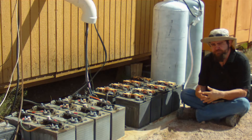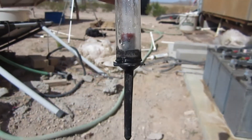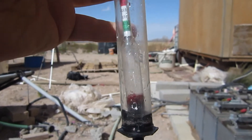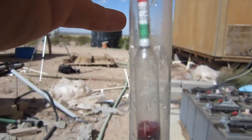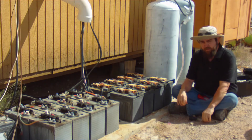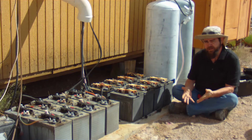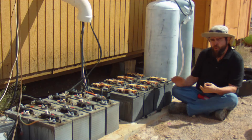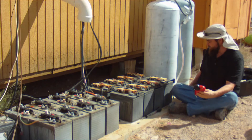Today I'm going to show you two tools. I have a traditional hydrometer here that you'd find at an auto parts store. It looks kind of like a turkey baster — you fill it up and the piece inside will float, and where the water level crosses the scale is the specific gravity measurement. This particular design does not compensate for temperature, and while these cost six or seven dollars at an auto parts store and work fine for relative measurements, if you really want to track actual specific gravity you need to pay close attention to the temperature of the electrolyte.